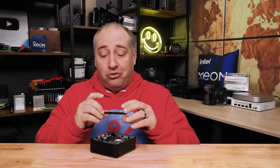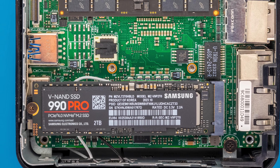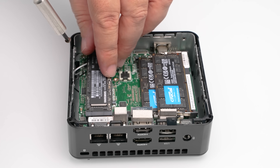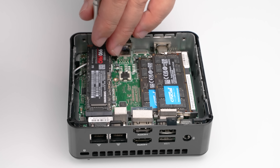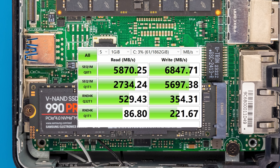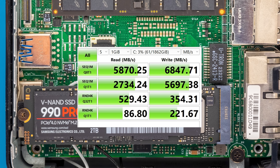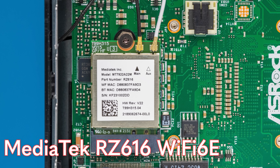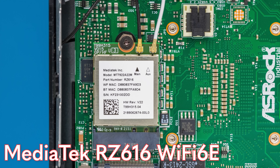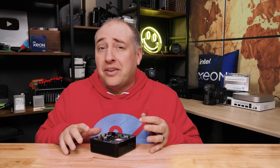We are using a 2TB SSD, and a lot of folks might also use a 4TB drive given recent price drops. One tip: this system does not have the most room for a double-sided SSD, so I'd prefer a single-sided M.2. We've been using a Samsung 990 Pro 2TB and it's worked fine, but I'd probably go with a lower-power SSD if you can. The Wi-Fi is a MediaTek RZ616, a Wi-Fi 6E solution with Bluetooth. So this system has a 1GB NIC, a 2.5GB NIC, and Wi-Fi 6E — three network connections without needing a USB dongle.